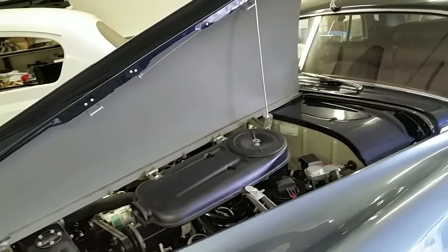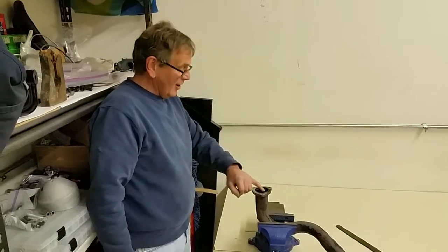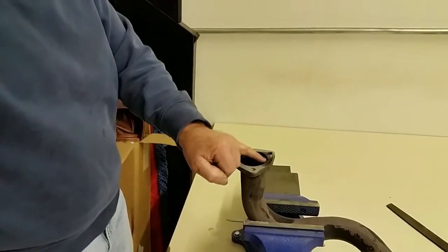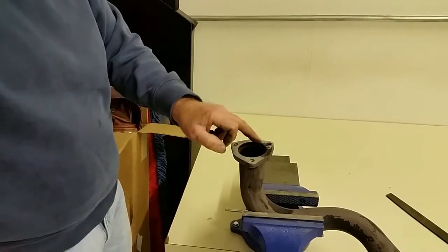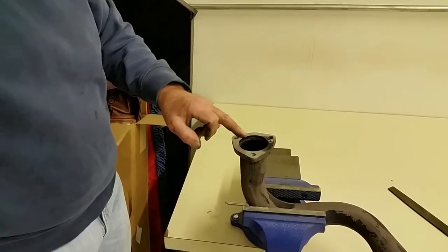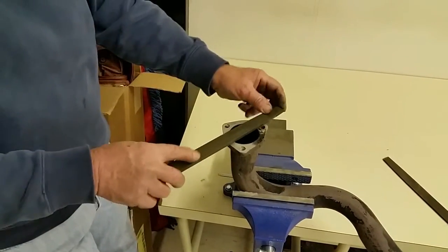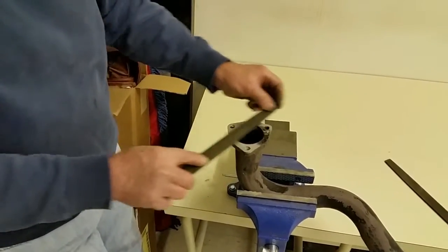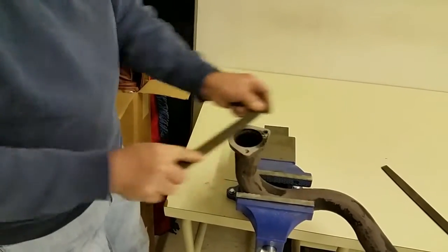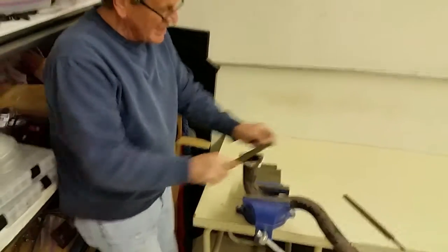Here is scene 1, take 1, video 1. So you've got this flange on the exhaust, and when they weld inside there, the flange gets distorted, so you end up with low spots where the gases can blow out. So you probably have to flatten it off, do it by the side of the file, or draw, what we used to call draw filing. So you're just drawing the file across to try and get a decent flat surface.